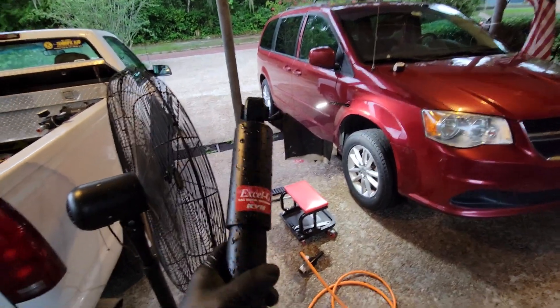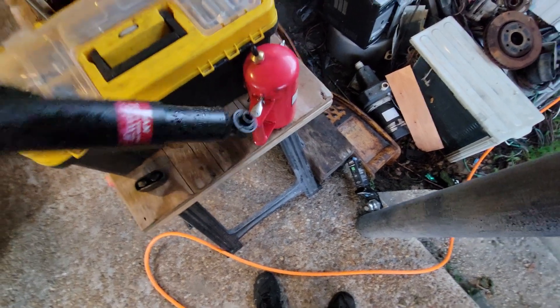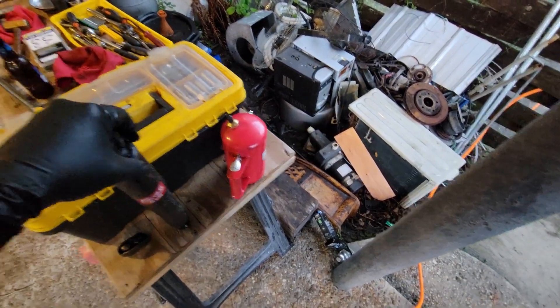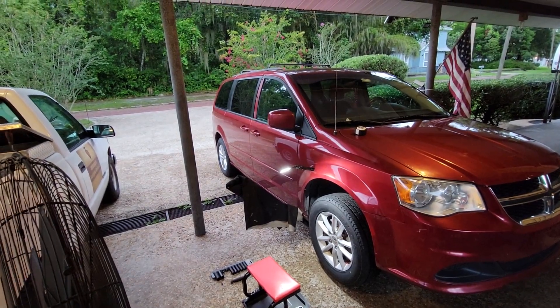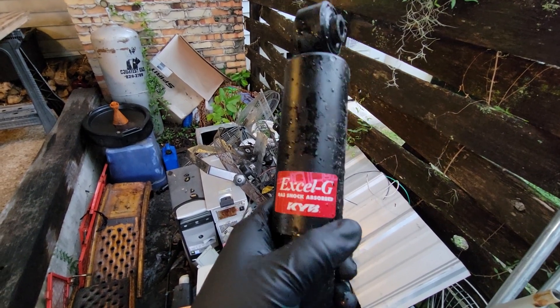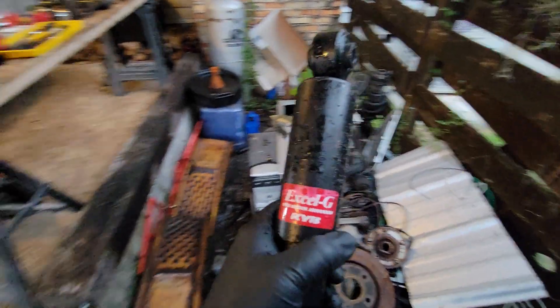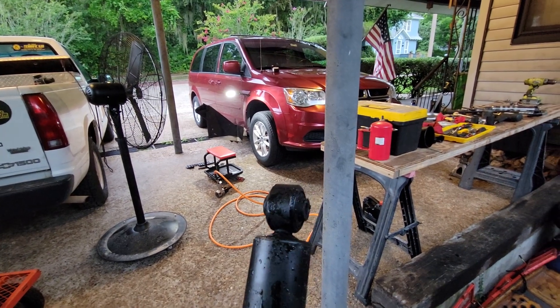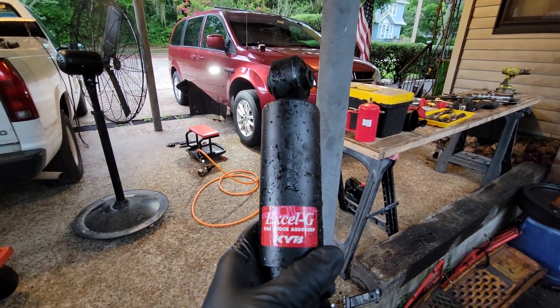Also real quick — on these Dodge Caravans I did not know this, but the rear shocks are a hydraulic shock. I pushed down on both of my rears and they stayed where I put them, so I thought they were bad and bought new ones from KYB. The replacements are substantially smaller and gas-filled, not hydraulic. When I put those on my van it acted like I had blown shocks — pulling up to a red light the van would bounce up and down after stopping. Do not put those gas-filled KYB shocks on your Dodge Caravan.